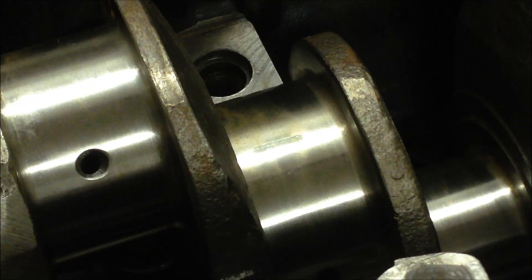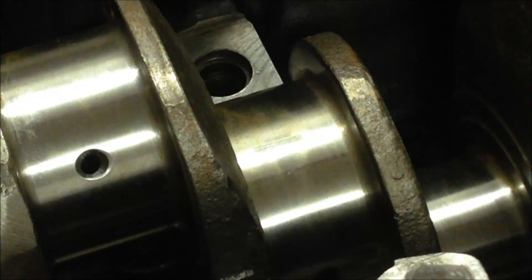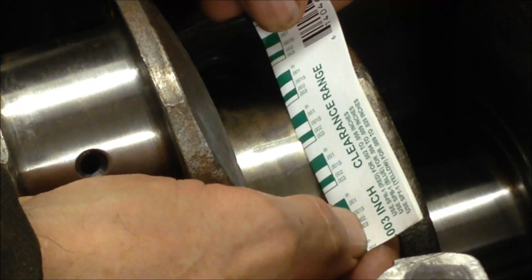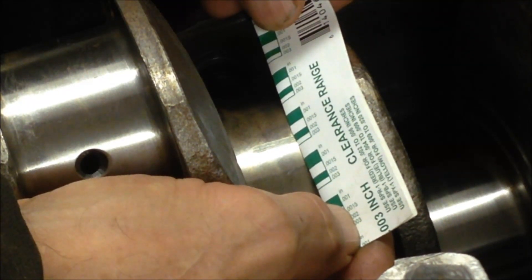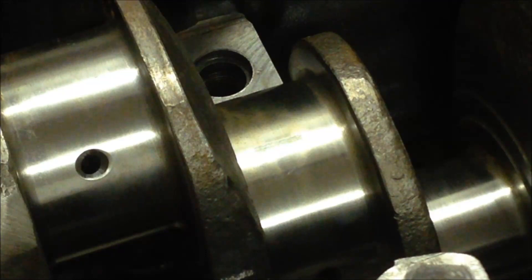Whatever footprint you have left, you want to check the thickness of that line. That thickness correlates with the chart right here - you just line up the chart that matches with that particular line. If I do a quick check, it looks like it's somewhere between one and a half and two thousandths. I think on this one the spec is one and a half to three thousandths.